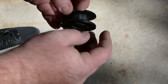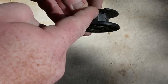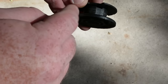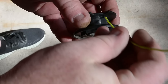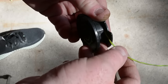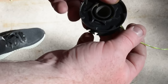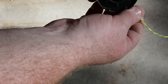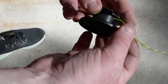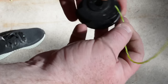The way you do it is there's a little slot right there — a little hole — and once you thread it, it can only go in one way. If you try to put it in the wrong way it doesn't go at all, so then you know which direction it goes. If you look closely you can see it wrapped around right inside — there's a little spot for it to wrap around. You don't need to go in too far, and then it actually shows you which way to wind the line, so you just wind it.